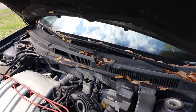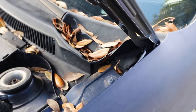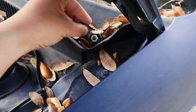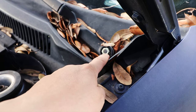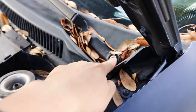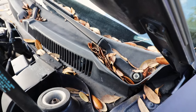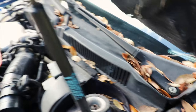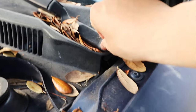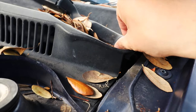The first thing I have to do is pull out all these leaves, then pull off this cap here for the wiper arm - it just comes right off. I believe this is a 13 or 14 millimeter - I'll know in a second. I need to remove the nut there and the one off the other wiper arm, pull the wiper arm off itself, then pull the wiper cowl off. The ECU is just held in by two harness clamps - it is a 13 millimeter. I went ahead and just broke those loose, so just remove the nut on both arms.